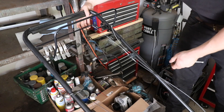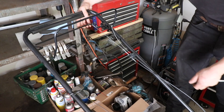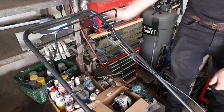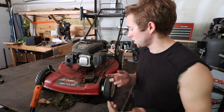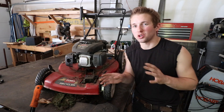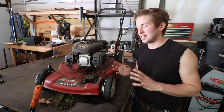When I lift up on this it's just like maybe an eighth inch of free play, and then that pulley starts to grab. Perfect. So it seems like this repair is going to be very simple — all it really was is a bunch of decaying grass clippings caught up in this pulley, and there's also a stick. So try not to run over sticks. Then the linkage just needed some adjustment.